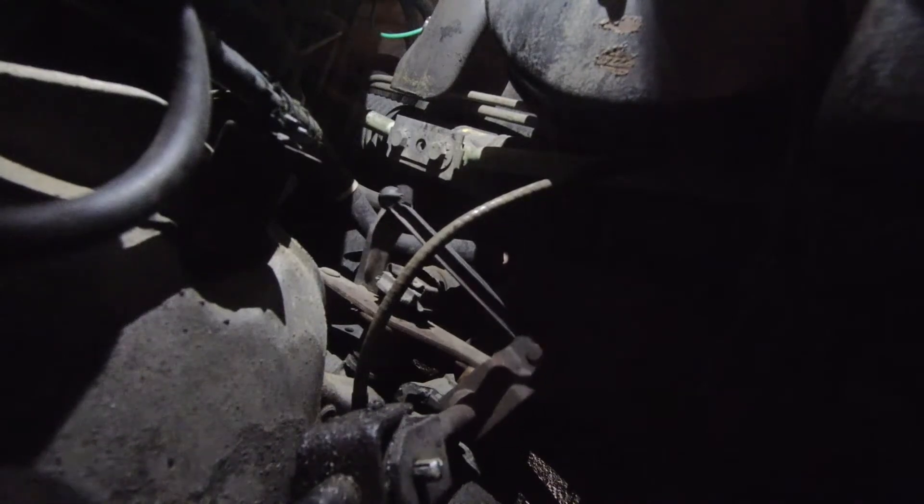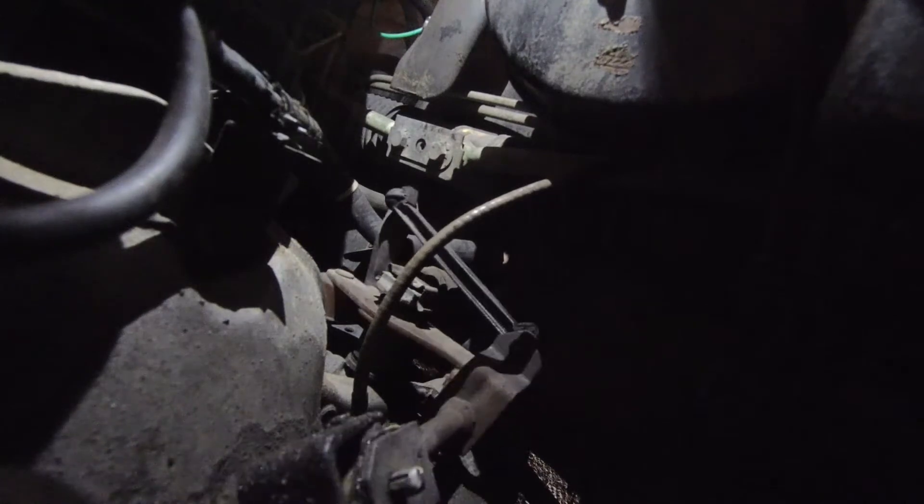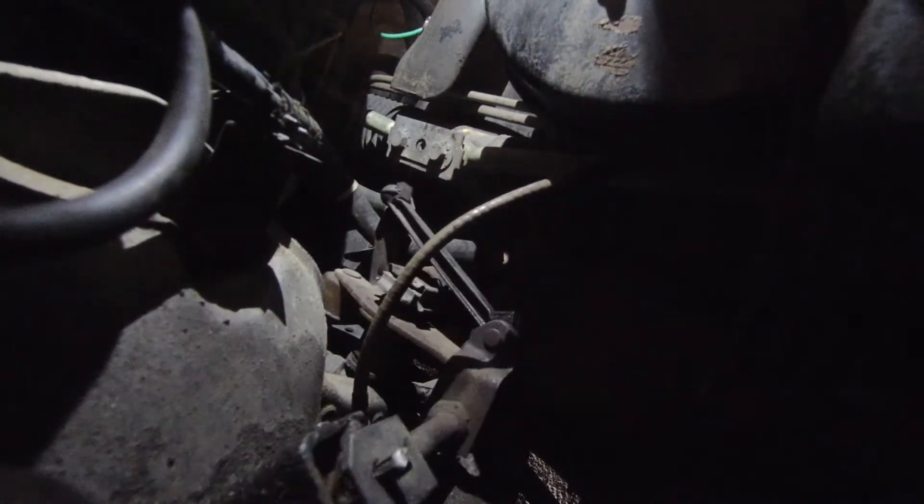This is how much play there was with the old bushings — it was pretty bad. The plastic rod actually bends a lot when you're shifting, so it makes for really sloppy shifting. The new stuff should make it really better.